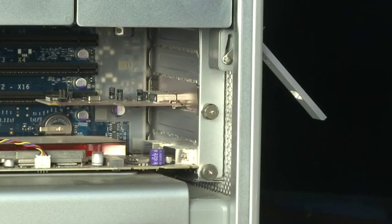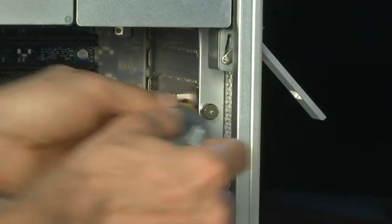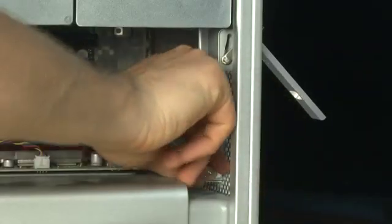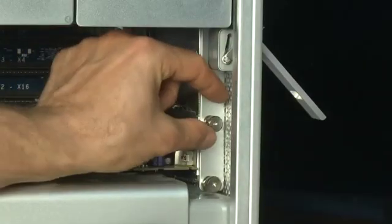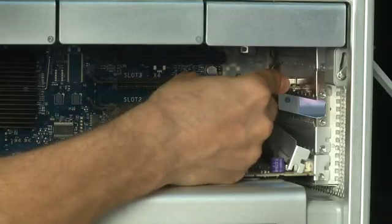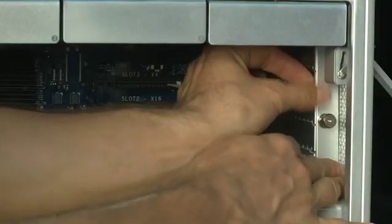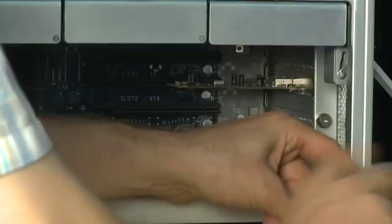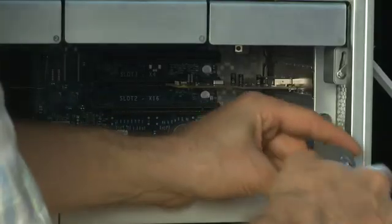The process is very similar on the new Intel Towers with one major difference. Instead of individual screws holding the brackets in place, there's a single clamp with two screws that hold all of them in place. To gain access to one of the slots, first remove the entire clamp by unscrewing the two thumb screws — you can get it started with a screwdriver if you have to. Carefully push the card into the slot, then place the clamp back over the metal brackets and screw it back in using the thumb screws, using your screwdriver to tighten it up all the way.